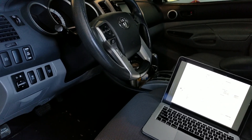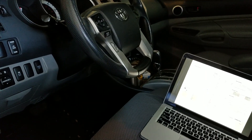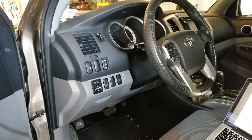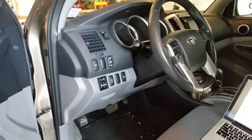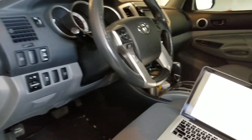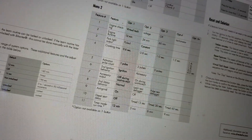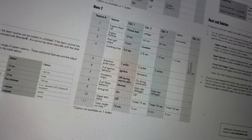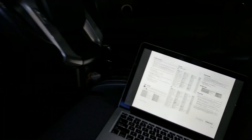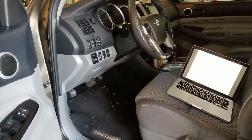Now on to fixing the issue I had. Certain vehicles crank a little longer than others — these Tacomas, it's kind of a known thing, it takes just a little longer to crank. I went to two different places in the city and they told me it's normal for it to take a couple tries to start. I just wasn't having any of that. So I found an installation guide for this particular remote starter and discovered that Menu 2, option 4 — cranking time — you can actually change it from 0.6 seconds, which is the default, up to 1.2 seconds. People on the Tacoma Facebook page have been dealing with this issue for years.